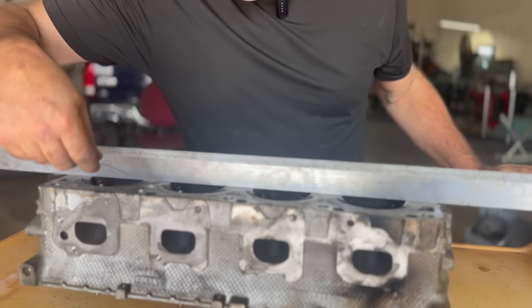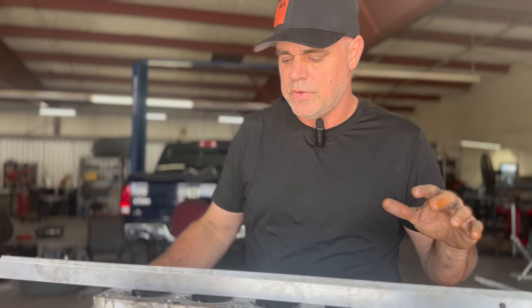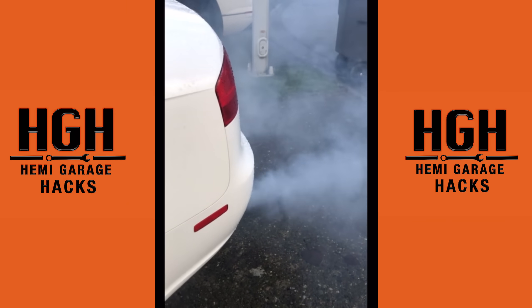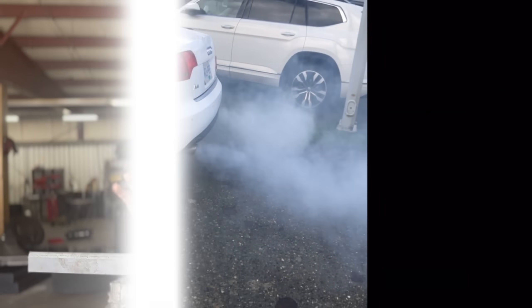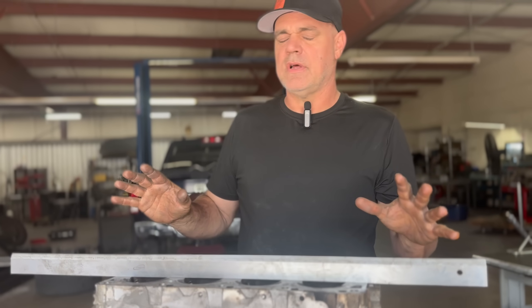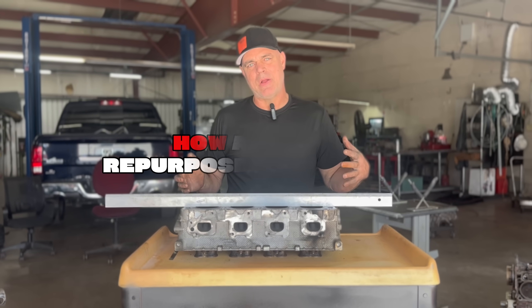But in through the middle it's blown all the way through. If this head is put back onto a motor, reassembled and started up, it's going to run terribly — it's probably going to smoke, it may not even start, it just won't have enough compression to run. So that's the background of a blown head gasket: what happens and how we check it.